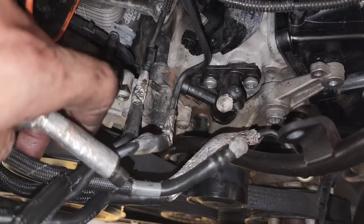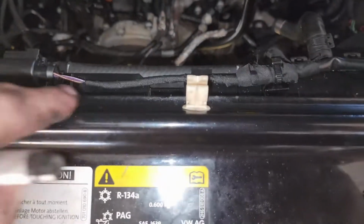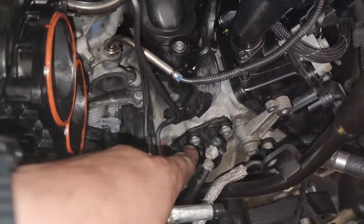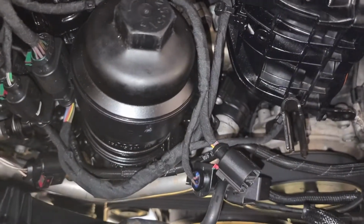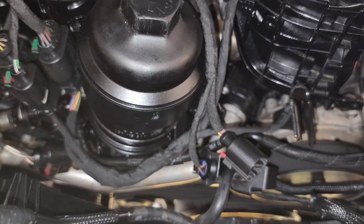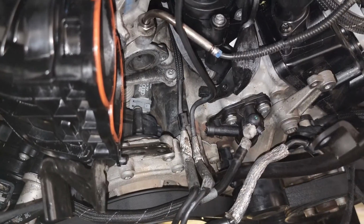This hose just here needs to be replaced as well because it connects that to that. This part here connects to the radiator or the coolant return. However, there's another one of these on the opposite side just behind the oil filter. So now I have to dig out that one there to pull it out, to replace that whole area just in there. And if you thought that the $950 for the butterfly valve was bad, I've now got to pay $250 for two of these dicky little things with some plastic pipe in between. But anyway, that'll do you guys for today.